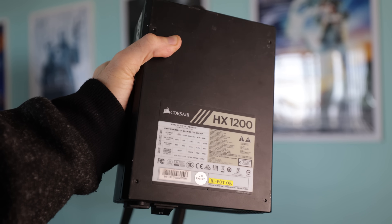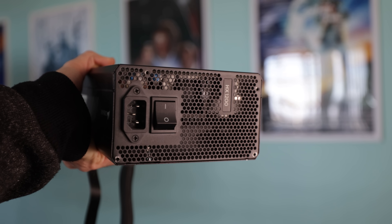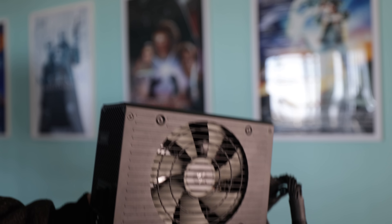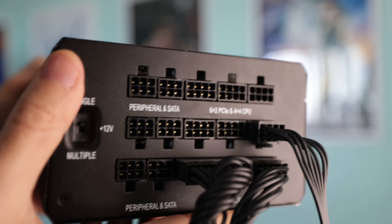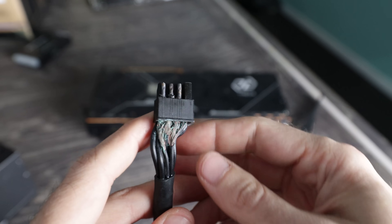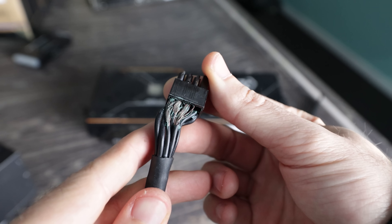Though in the case of the 6700 XT, you should be fine with a piggy tail cable. Lastly, it is simply a matter of heat — the weakest point being the modular connection from the power supply to the piggy tail cable. If we look at this HX 1200-watt power supply that I bought here, clearly the miner I bought it off did not follow this advice. Though it's good to see that the power supply still works absolutely fine, and Corsair's safety features work fine too. In this miner's case, they may have used two RX 570s on one piggy tail cable — these cards have a TDP of 150 watts each, therefore becoming 300 watts together, going well over that 225-watt recommendation. If used for mining, this could have melted the cables fast and caused the oxidization we're seeing on this cable.